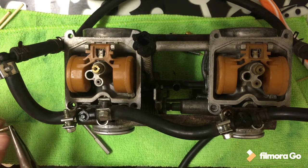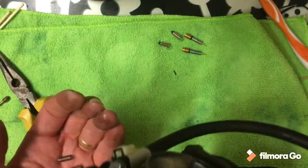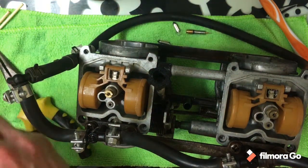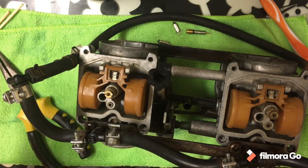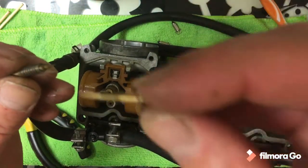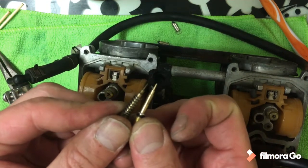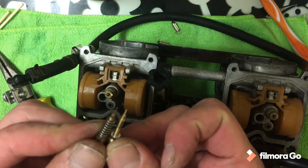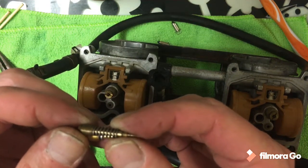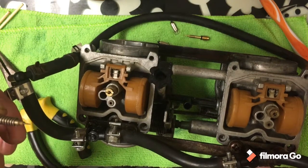I'm going to have to turn this upside down — didn't want to ruin the shot, but I need the spring out as well. I'll spray some stuff down there. That's what I'm replacing it with — oops, spring's just slipped off the end. Replacing that with the new one. Doing a like-for-like comparison — it's difficult to get the focal length right, but actually the old needle doesn't look too damaged, still got a decent point on it. But it's got no rubber and no washer on it — can't guarantee the seal. So the new one is only going to do better.